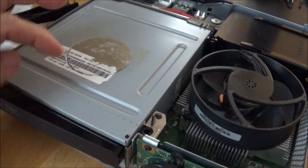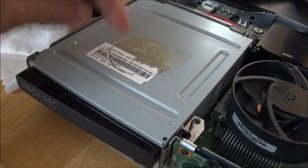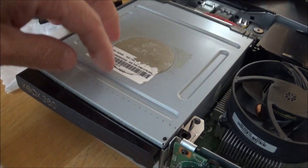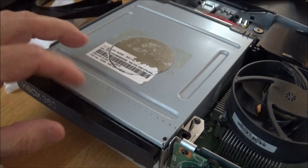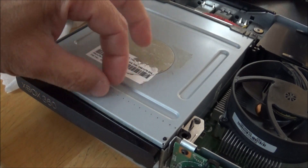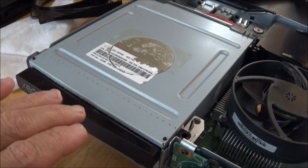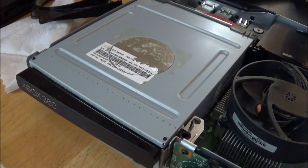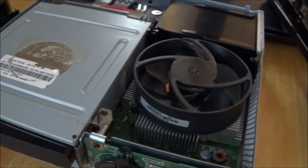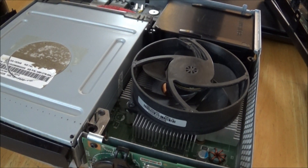If you want to learn how I fixed this tray from popping out — there are some gears in here — I'll put the link to that video in the description. I was able to fix it because it's a timing issue: there's an arrow here and an arrow here, and they have to be aligned facing the opposite direction so the tray can go back in. I don't know what it is about the Xbox 360 but my kids love playing it more than the Xbox One and the PS4, so I try to maintain and clean these as much as possible.